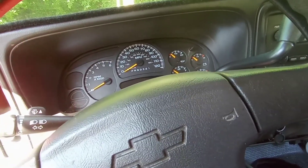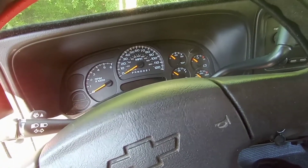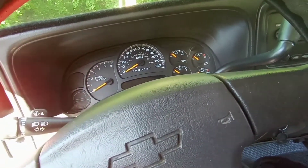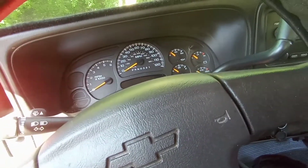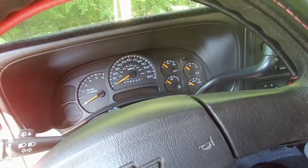My fuel pressure is 58 to 60 psi, so that's normal. I cleaned my injectors — everything's fine there. I did my intake gaskets, there are no vacuum leaks or anything. So yeah, maybe it's just a 4.8 and it's really slow and I just need to accept it.